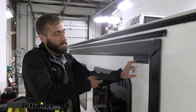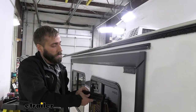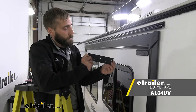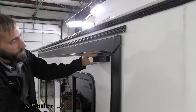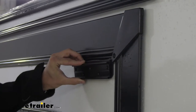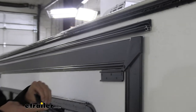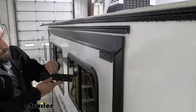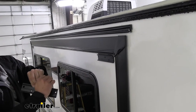On our J-Feather today, the factory already installed our access plates. If yours did not come with this already installed, you would need to first place some butyl tape over your screw holes in the access plate. Then you're going to want to put your access plate as far up as you can and as far over towards the edge of both sides of the T-molding. When you put this on, you're going to want to have your tapered edge down and this lip right here facing up. When installing your access plate, use the flathead screws — those are going to sit down inside of the bracket so that you don't have any issues sliding on your access bracket.